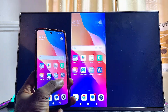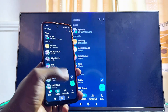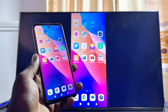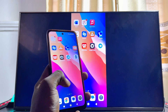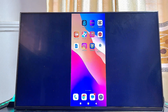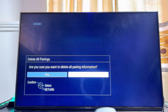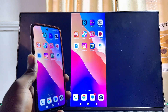Automatically your phone will be mirrored to your Panasonic TV — it's currently connecting to the Redmi 12 and as you can see it works pretty well. Note that depending on how strong your Wi-Fi network is, you might have to try this several times. In my case I had to connect to another Wi-Fi network before it worked. If your phone can't find the Panasonic TV name, go to the Screen Mirroring settings, delete all paired devices, then try clicking the cast option several times.